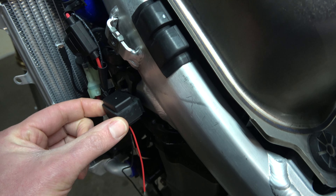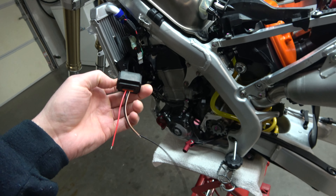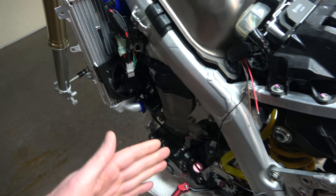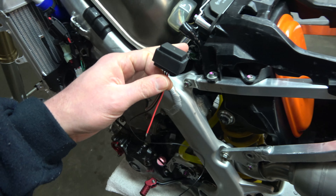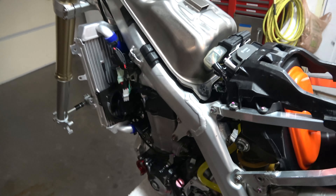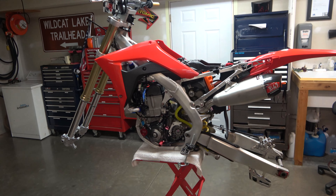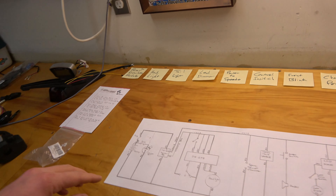From this point we're going to start positioning all these components and figure out where on the bike they should go. We'll take all the individual components, physically put them on the bike, then start measuring cable runs to see how long each wire needs to be. I have a general idea of where the harness is going to lay but haven't worked out the details. I think we're going to put an end to this weekend until the headlight arrives - should be shipping to my door this week. I'll show you what we look like so far.